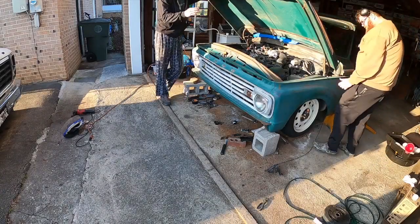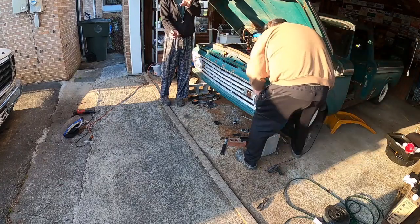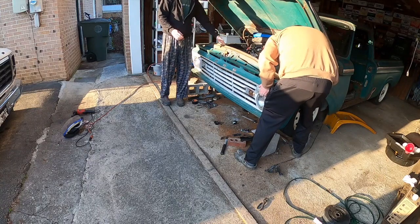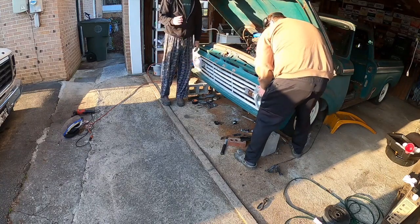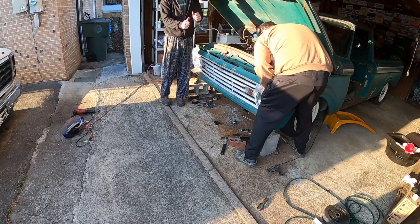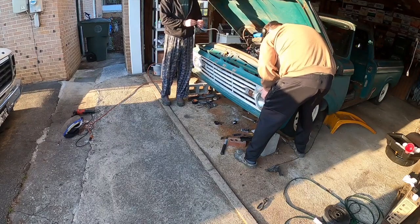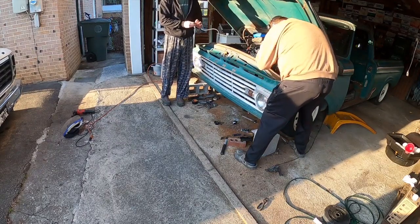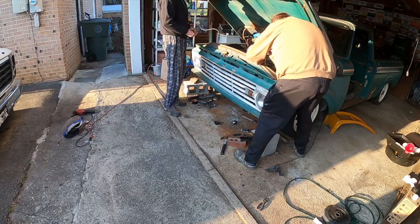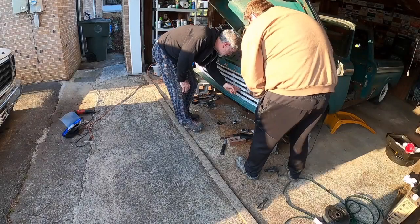On the back of his, in the actual truck, between the two holes that sink in where you bolt the door hinges back in, be careful on the grill up here, make sure we don't bang. He cut out like an oval shape that you can put one of those rubber plugs in to be able to get a wrench in there and tighten up that bolt that's inside on the fender without having to go through the door hinge bolt area.